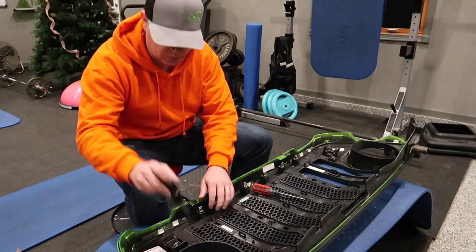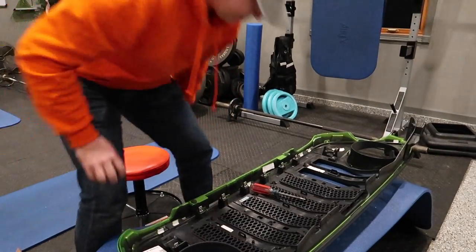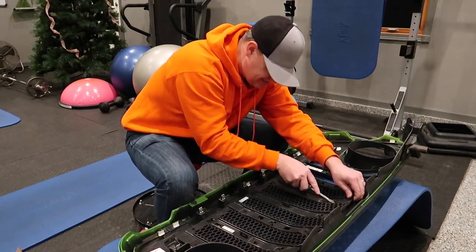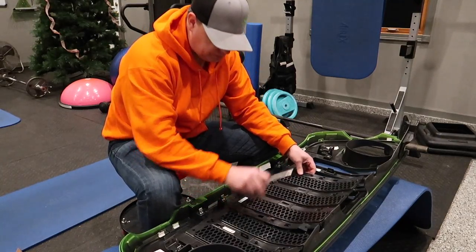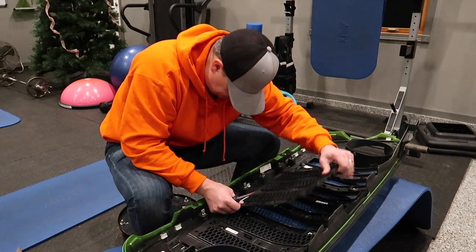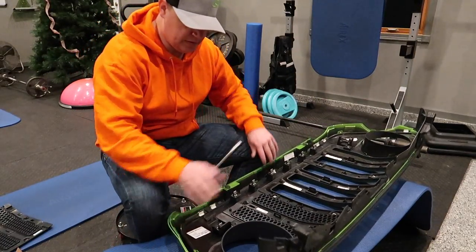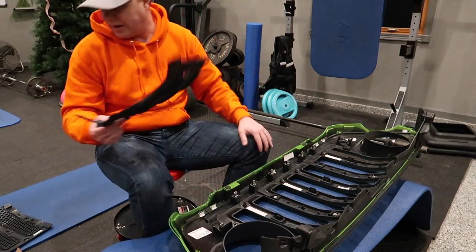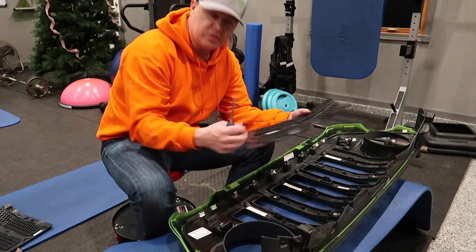I've got two more Torx T20 screws here because I didn't do anything on the far right side. Then I'm back to a bunch more of these fastener clips. Now that I've got the screws on both sides and the top, it does make things a little looser on the bottom. Just like that I was actually able to work it out without unclipping them. Then I just got to get the passenger side one out — the top one first and then it just releases from the bottom. Pro tip: get the top one loose and it'll just lift up and out of the bottom.